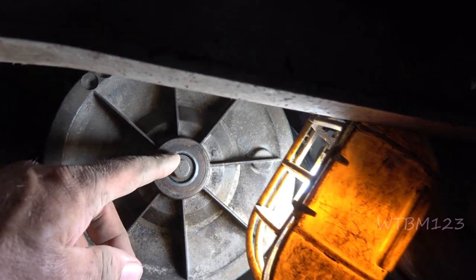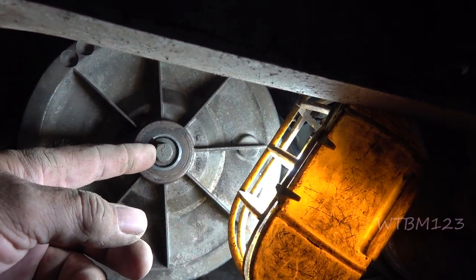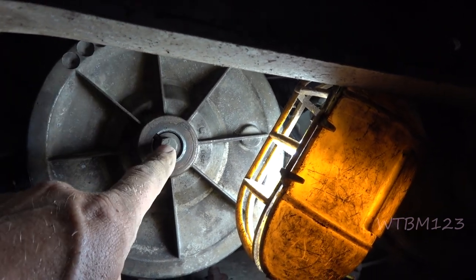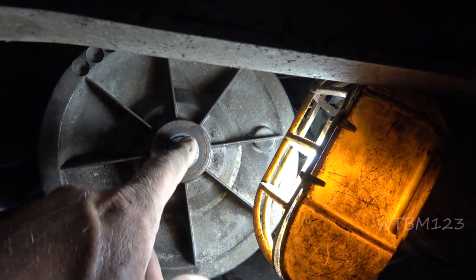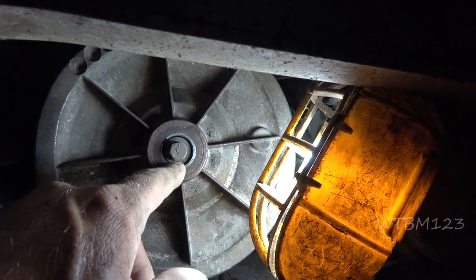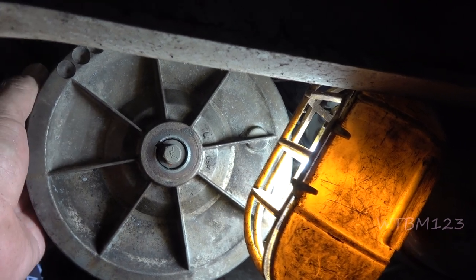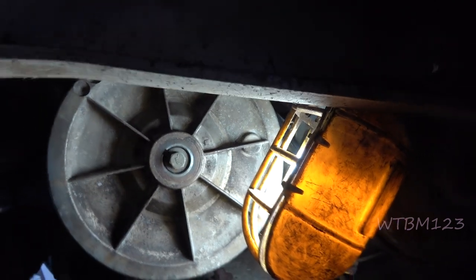So there's that bolt on the clutch — I took it out, took the big washer off of it, and just left the little washer on and put it back in, ran it down finger tight. My plans are I'm going to spray this again with some penetrating oil, but I'm thinking about going on the back side with the pry bar, just pulling out a little bit, and hit this with a blunt air chisel and see if it pops off or not.